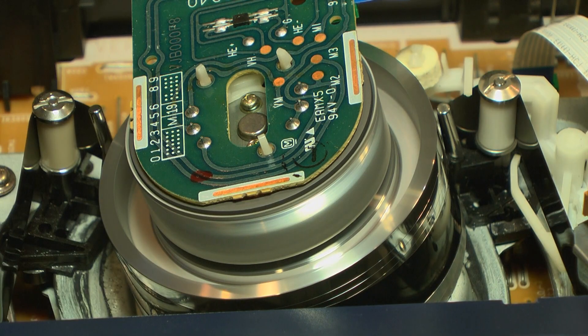The signals recorded onto the tape look something like this. Recorded along the top of the tape is the audio signal. Along the bottom of the tape is the sync or synchronising signal. And between the two are the diagonal lines, which is the video signal recorded by the video head. The signals are all combined to look like this.